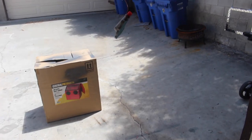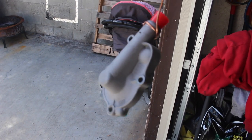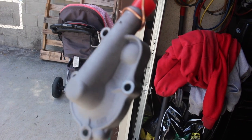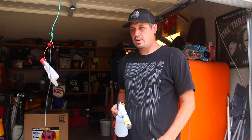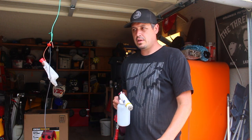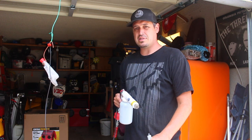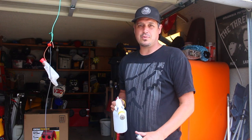Let me show you what I've done to prep for powder coating this small part. I got the water pump, got it all sandblasted and cleaned up, as well as got some degreaser on it so she's clean. I'm about to hit this with the powder coating gun - got it plugged in, all I gotta do is send the charge to it and start shooting. First time using this gun so we'll see how it goes.